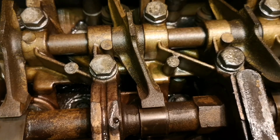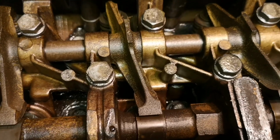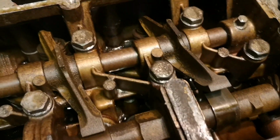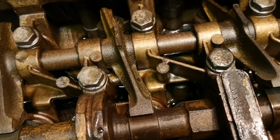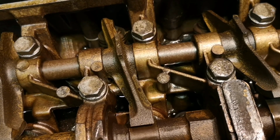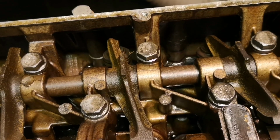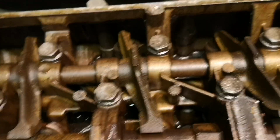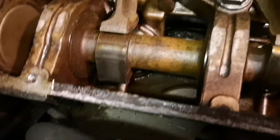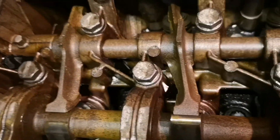So we have. Is it a double? It's not a double. Can't be. Worm drive for your Dizzy. Yep. Makes sense. There's your cam. Yep. There doesn't seem to be enough. What? Oh no, one cam does both. Yes. Oh, that's almost clever. Yeah. So one is direct. The inlet's direct drive off the cam. And then there's a finger that runs the exhaust. Finger of fun.